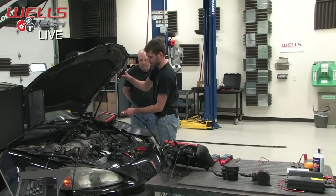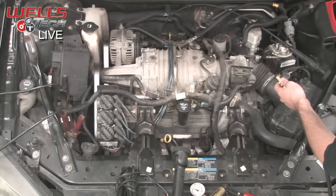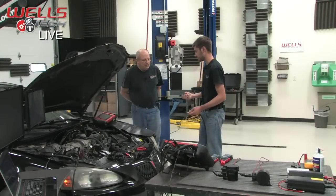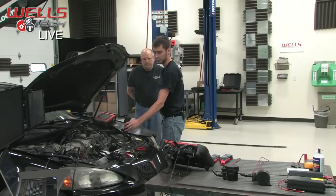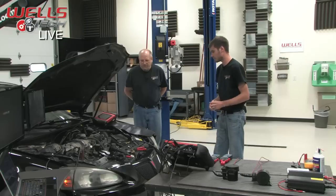You can see, as we shine the laser light through the path of the smoke here, as I move it around, right by our EGR valve there. The cameras are tough to pick up lasers, but you can see the actual beam of the laser, where when you're not in the smoke, obviously you can't see it. Yep. So that is a really helpful little diagnostic tip, a laser light can help with that. Right. Otherwise, a lot of smoke machines will come with a super bright light that can really help as well. Yep. Good tools.